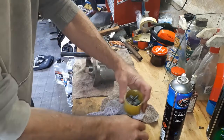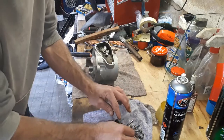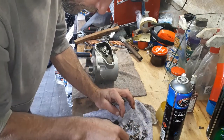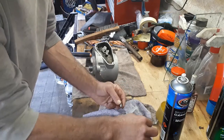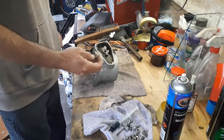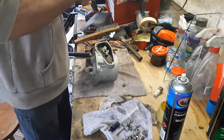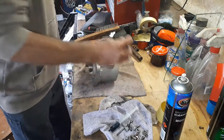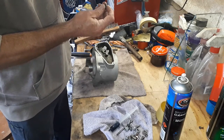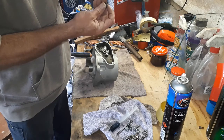And I'll just quickly tip out all the nuts and bolts. If I can find the right one. Pretty sure it's that one, and the washer. Go on this outside here. I'm going to put a little dollop of Loctite on those as well, just to make sure that they don't move anyway. I'm just using blue Loctite, so I've got half a chance of getting this out again.